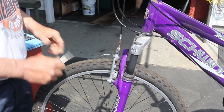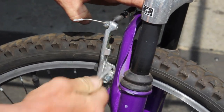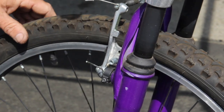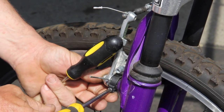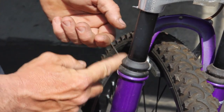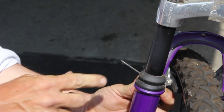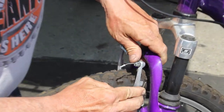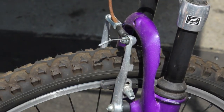This arm is still not cutting it. Some bicycles have a spring that comes up the side, and this one does. Here is a trick of the trade — you're going to remove that spring using a flat-bladed screwdriver, pushing down on it carefully, because it'll flick out and bunk you in the nose. I'm going to back off on that screw again, and I'm about to get a little violent here — good for the brake. We're going to give this spring a little bend, grabbing here to here and giving it a little tweak down, pushing back and pulling down. Then force it right back into its hole. Look at how that brake is working now!